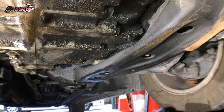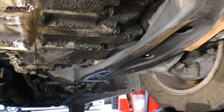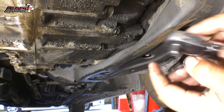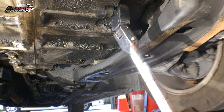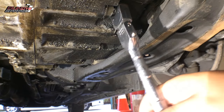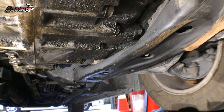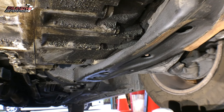In the previous video you can see we got the feed tube back out of the fill plug pretty easy. There's a little o-ring on the fill tube that dumps back into the transmission, so I'm going to change that out — picked that up from Honda, I'll put a part number up. Now we're going to drain the transmission. There's a plug right here — just use the 3/8 part of your ratchet to get it loose, righty-tighty lefty-loosey. Got it loose, just give it a good yank. Get a pan to catch it — I'm going to let this drain for about 24 hours if not longer.